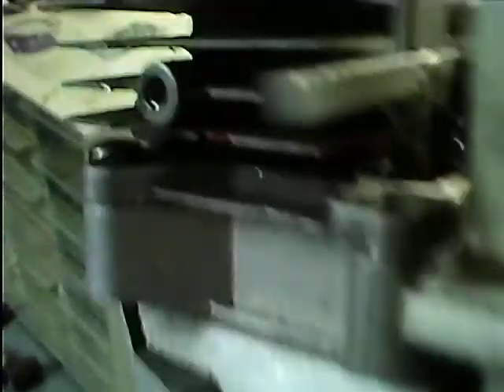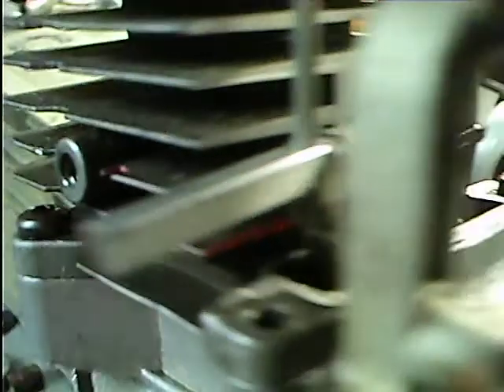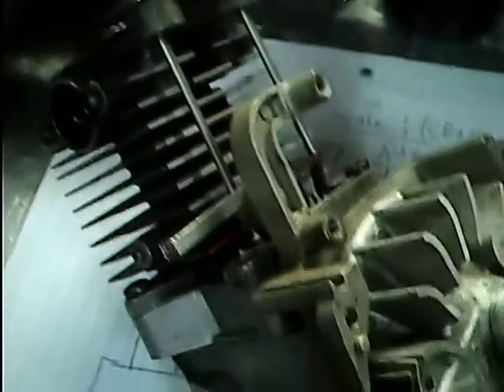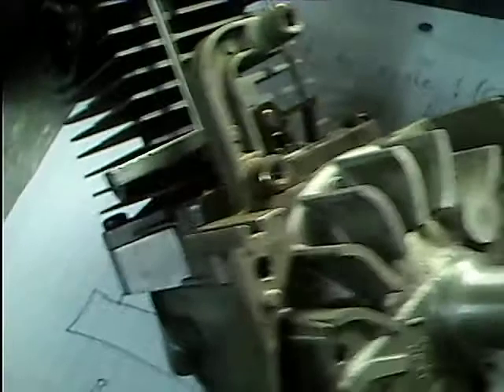This little piece of keystock right here is what I just epoxy or JB welded to the normal rocker arm. I wanted to have it welded on there, but since the rocker was hardened steel and the piece of keystock I used is mild steel, I would have had to anneal the rocker and then re-temper it — just not feasible.